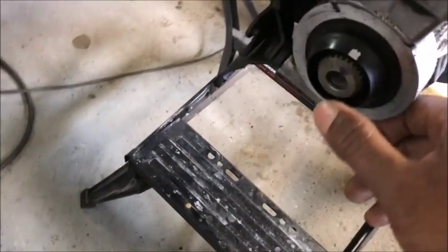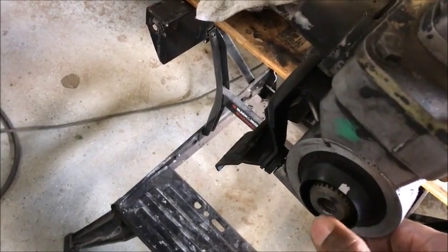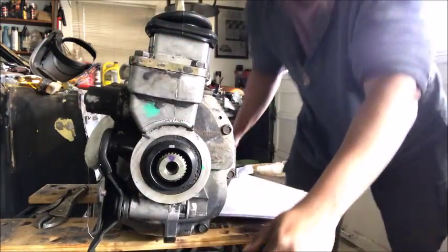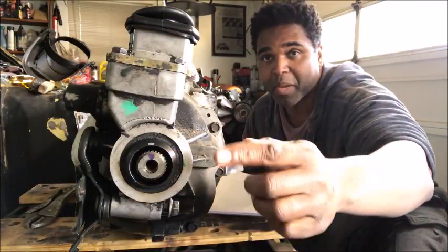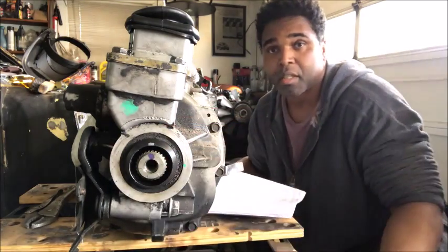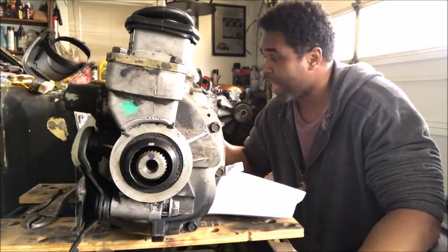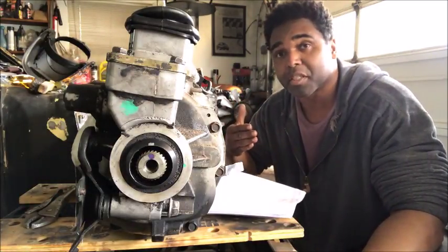I marked the shafts with a little Sharpie — you can see it. I've marked everything at 12 o'clock: 12 o'clock on the input shaft mark, 12 o'clock on the output shaft. This will show you the relationship when I turn the input shaft one time. I'll shout out 'full turn' each time. In first gear — which is a 2.66 — on that input shaft it should be a little past the halfway mark. Let's begin.